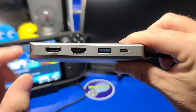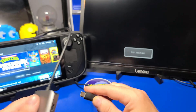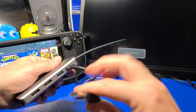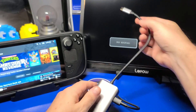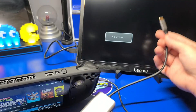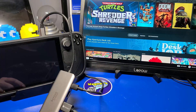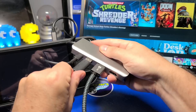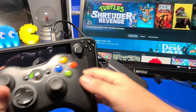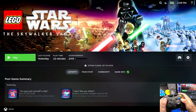Let's try out the dock and test the HDMI connection, as well as a wired USB controller. We'll plug in the power from the Steam Deck to the USB-C port to allow charging while connected, and an HDMI connection to this portable monitor. The HDMI cable will be plugged into HDMI 1. We'll now take the Steam Deck and plug the USB cable from the dock into the port at the top of the device. As soon as we do, the Steam Deck will auto-detect the HDMI connection and send the audio and video signal to the connected TV or monitor. Now we'll try out this clone Xbox 360 wired controller by plugging it into one of the available USB ports — there are two USB 2.0 ports and one high-speed USB 3.0 port on the dock. No button mapping was necessary; the Steam Deck automatically detected the controller.